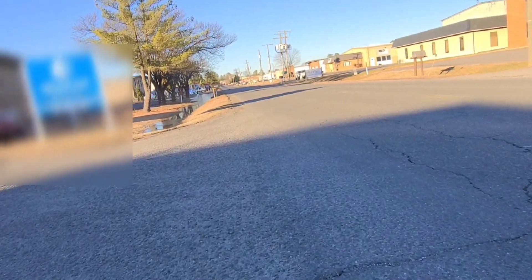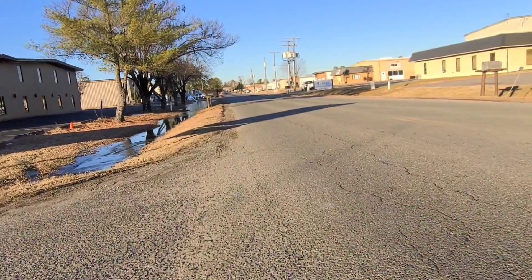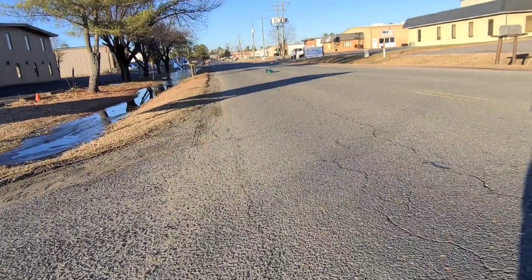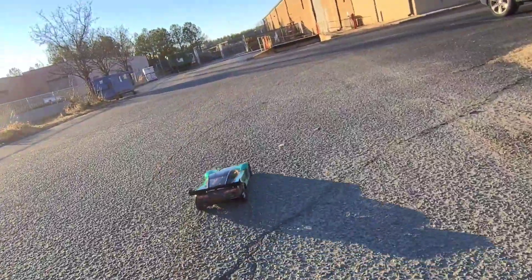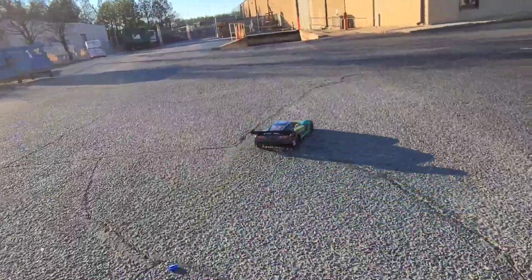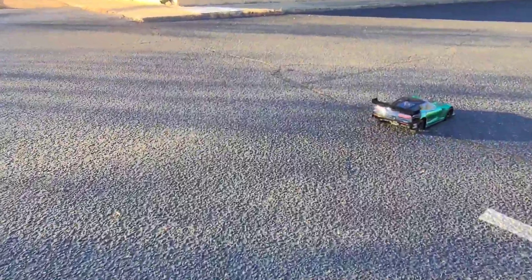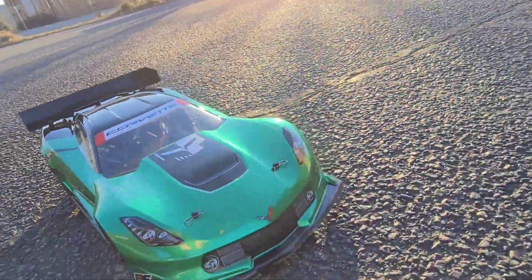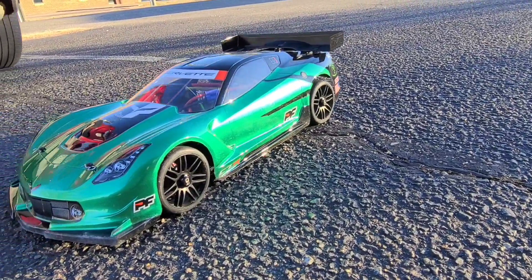Gyro is entirely too high. That's why that was a practice run. Didn't even turn on the GPS, I just realized. She was moving. This is where a regular scoop is off. Doesn't look like we damaged anything, just a little bit of dirt. Let me turn down the gyro, and we'll do another run with this battery, and then we'll put the big battery in it.